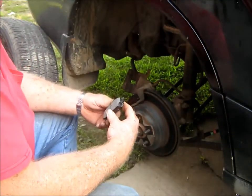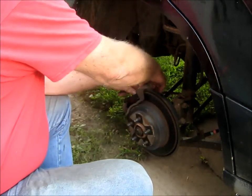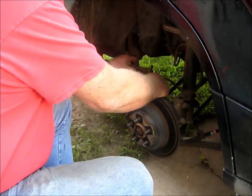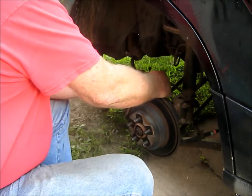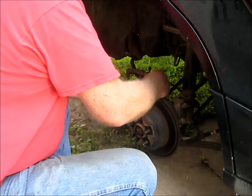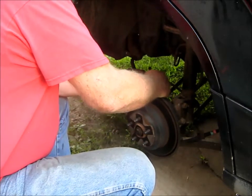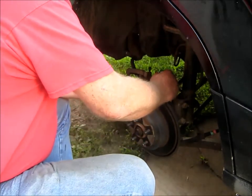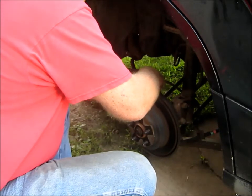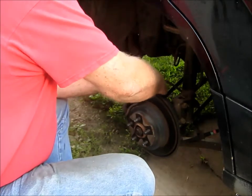We'll get this one - obviously it goes on the other side. It's a little more tricky because you've got to get on the other side to see it. That's good. Actually, you should probably tie this thing up with a piece of wire, because you don't want to bust your brake line back there. It's got to be in the little clips like this. There's a little dirt there - that's not helping either. Got it right there. This one is supposed to go up in here - it's better if you can get them started at the same time.